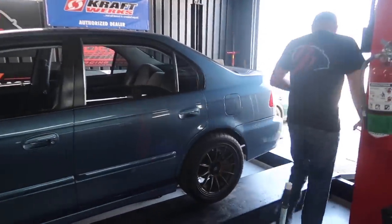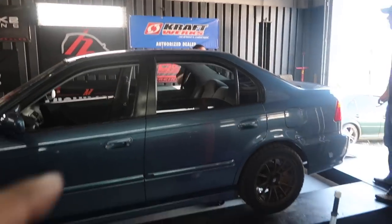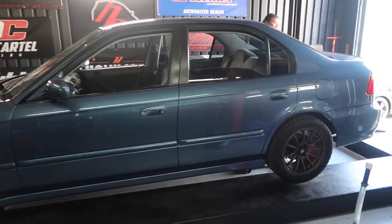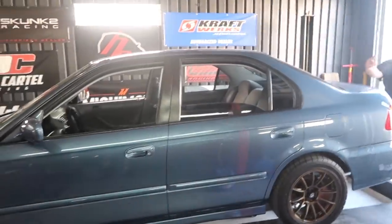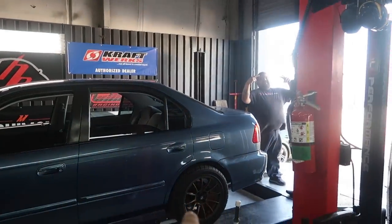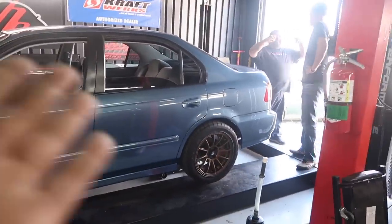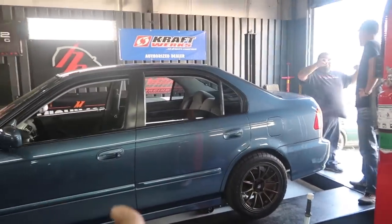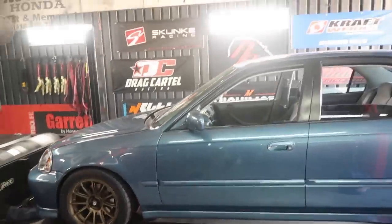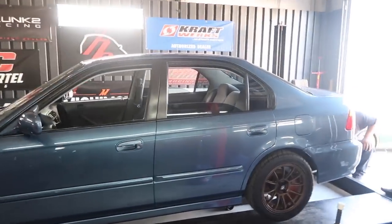All right, guys, this is something you will never see someone talk about with an all-wheel drive car, and we did not know until now either. When you go to put the drive shaft back in after dynoing, you do have to lift the wheels off the ground. Otherwise, the car will move back and forth. If you get lucky, they'll line up, but they didn't for us, and we didn't want to do it here on the lift. So we had the rears lifted so we could line up the drive shaft on the front. Bo was putting the drive shaft on the front, and we rotated the wheels to make it all match up. It's something you should know if you're dynoing the car front-wheel drive: you might have to jack up the rear to turn the drive shaft where it needs to be to connect to the transfer case. So we're almost ready, but this is a little quirk we did not know about until today.